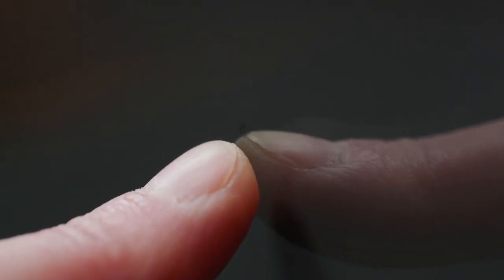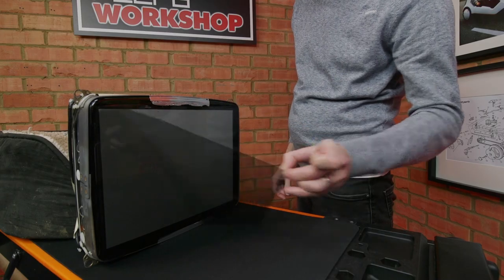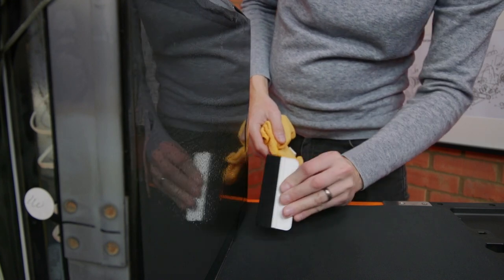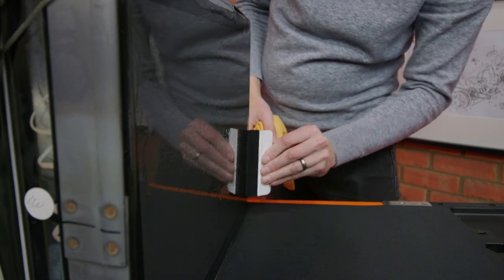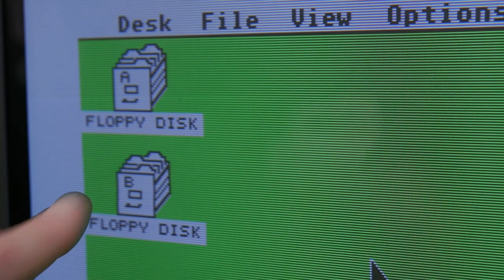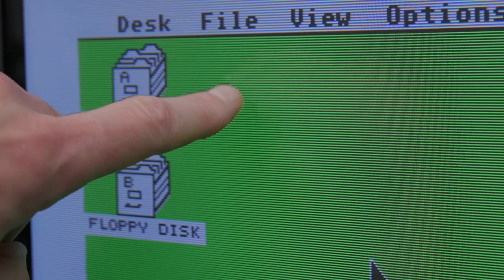This film really doesn't go on as nicely as the other type. Having finished, there's a defect right in the middle of the screen — this may have been some crud picked up from the workbench when I offered up the wrong side of the film. So I peeled it off and had another go. This attempt was just as finicky with small bubbles appearing, but eventually I was happy with the result. With the monitor reassembled and powered, I spotted another small defect — this one looks like a wrinkle in the film — but now I've run out of this darker film so I'm going to have to live with it.